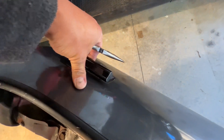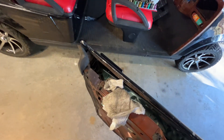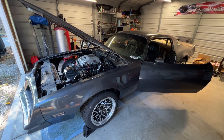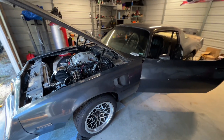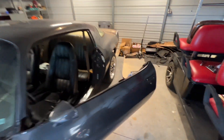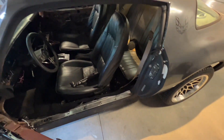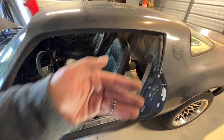Hey, we have a working door handle again! Let's put these window guides back in and then our door will open from the outside again. Wedding ring back on. Let's get these back on — they kind of marked right here. I did a little scratch mark where they were but they were all the way forward. Mark where those were so they have the right play in the window when it goes all the way up and seals.